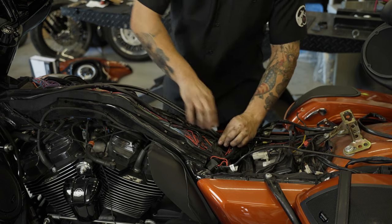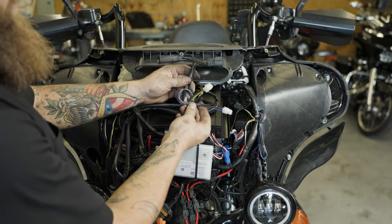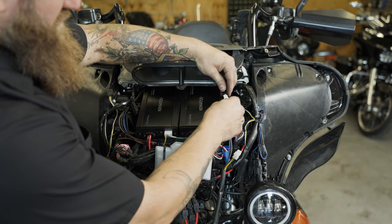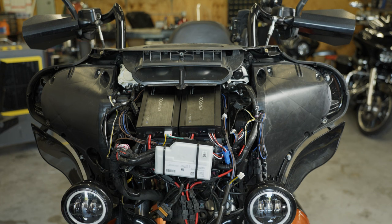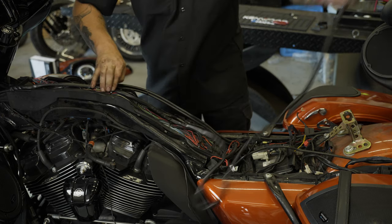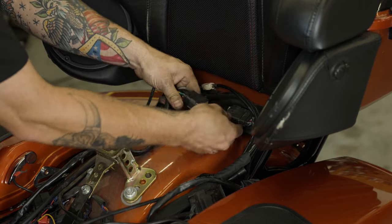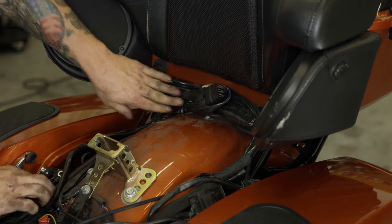The P-HD4UT includes a CA-HRN14UT harness that connects to the rear tour pack speakers. You will see that one end of this harness has two four-pin connectors — one of these will plug into the amplified output on the amp that will power the rear speakers. Plug the black eight-pin plug into the amplifier's input. The second four-pin plug marked rear-in on the rear speaker harness will plug into one of the blue four-pin connectors, noting they will only go in one way. The harness that will run the rear speakers will pass under the inner fairing on the clutch side of the bike, following the same path as the power harness wire. Locate the factory wire plug that holds the seat bolt on the back fender, noting that one side of the plug has wires going to each rear speaker pod. Separate the factory plug — one plug from the CA-HRN14UT harness will plug into each side of the factory plug just separated. They will only go together one way.